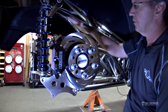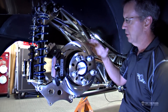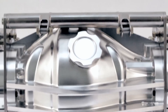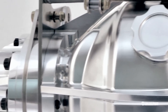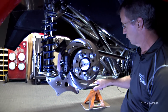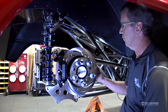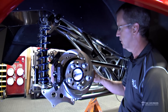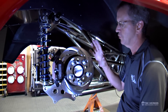This is going to be a top sportsman car, so this is a flanged axle housing — a 4130 sheet metal housing with flanged axles, Strange disc brakes. We have lots of different options on housings: flanged axle type, full floaters, the modular housing, or the full double throw-down billet housing with custom end bells. All this stuff is electroless nickel plated, which gives good corrosion resistance with no buildup, so it's easy to work on. This housing is more than adequate — this car is going to have about 1,800 to 2,000 horsepower, and the 4130 housing is well adequate up into the 2,500–3,000 horsepower range.